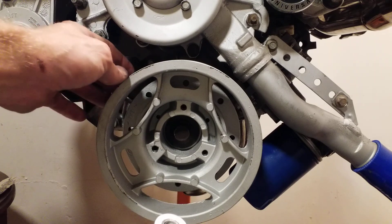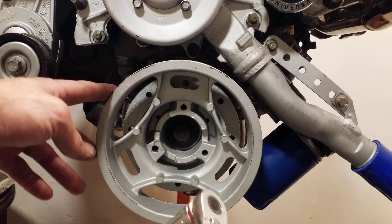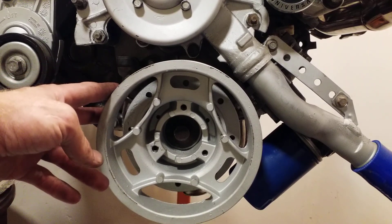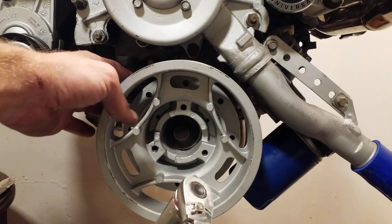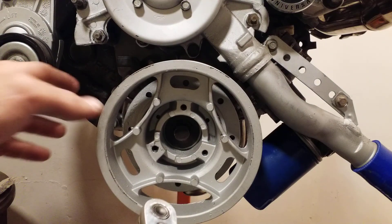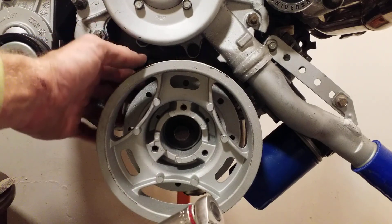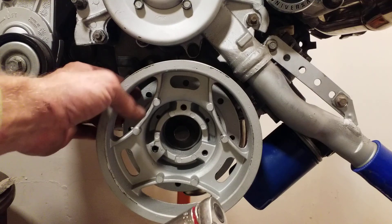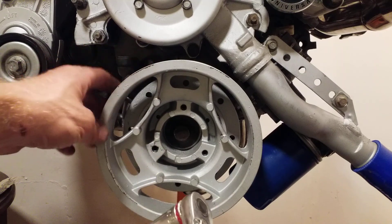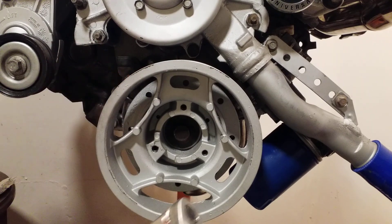The 1999 to 2001s are the one-piece design. The cool thing is you should be able to directly swap your year — so if you're a 2001 3.8 Mustang, you should be able to swap on a 2001 3.8 Windstar external-balance harmonic balancer without an issue. I've talked to at least one guy who ran one without any problems. With the one-piece it's really not making much of a difference — it's a matter of grams — so you can swap out your balancer the same way as if it was broken.